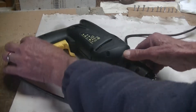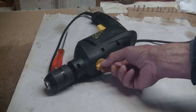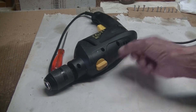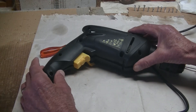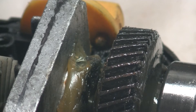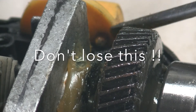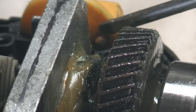I must warn you, be very careful if you're going to be doing this — be very careful about this little switch over here. This is the one that goes from drill to hammer drill. On the hammer drill switch, I don't know if you can see that little ball bearing over there. The first time I took the drill apart that caused a big issue.